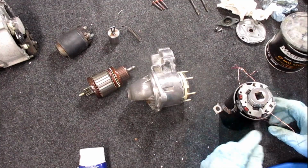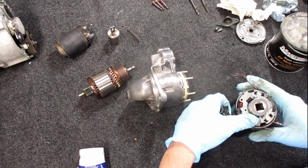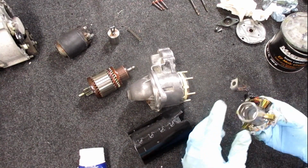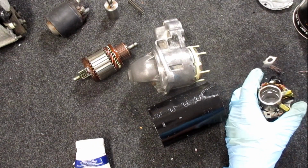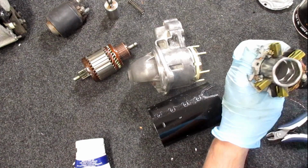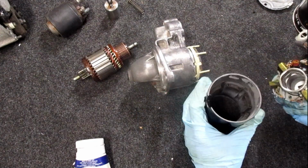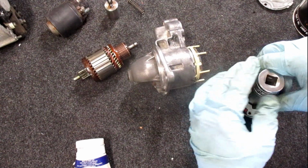Alright, now at this point, as you can see, the wires might be in the way, and I'm not going to better clip them. So, we are going to have to remove the retaining wires and be careful about the magnet with this socket, because it's going to want to pull the socket out. So now the socket is holding the brushes back. Try to keep this as close to the top as possible so we get it away from the magnets. Just like that.